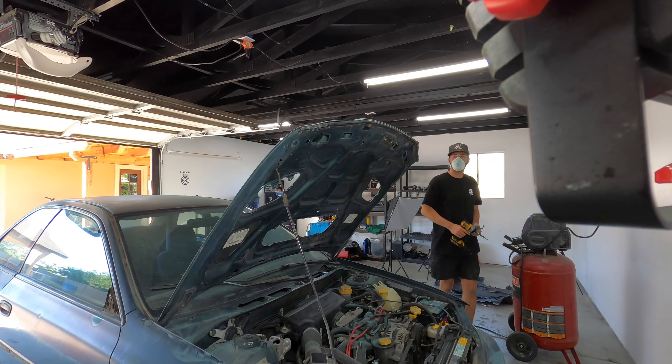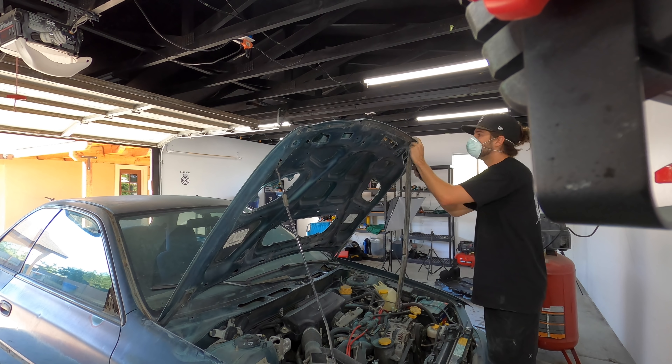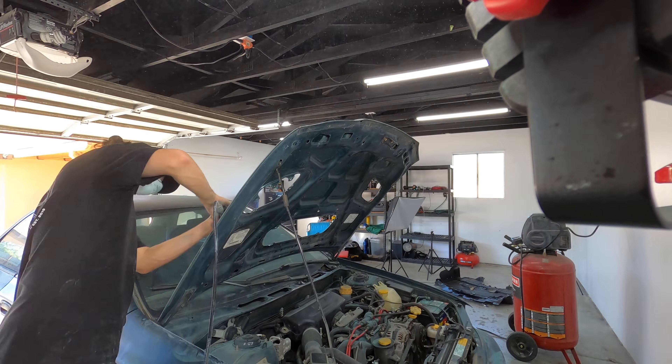It is a very, very important part to keep your safety at the top. I was still learning how everything worked, so before I move on to the rest of the car we will have a nice respirator that you will see here in just a little bit. I feel good. We went to 120 — it gets a little softer. You can kind of feel where the 80 grit was and where the 120 you just did. Then I went over the whole thing and made sure with my hand that it felt smooth. It almost reminds me of like when you see the guys shaping surfboards — I'm constantly thinking, is that smooth? All area is smooth. Okay let's switch to 240. Now it's really smooth. Now we can feel the areas, pop the hood, get the edges, get everything I can with the sander. Then later we're going to come back with blocks by hand and kind of touch everything up.